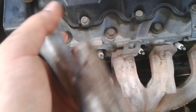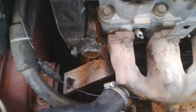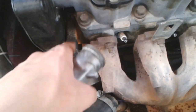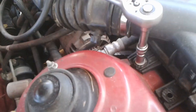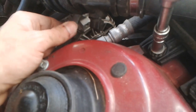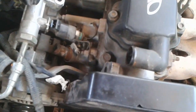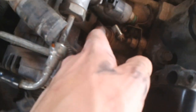The worst part of this engine is the cooling system hose outlets, which tend to rot as you can see here. Our engine's outlet is not much better, but I've got a new thermostat cover - a used one that the guy who sold me the engine gave me. Those plastic materials used on such things are the worst you can have on a car engine. When removing those two screws I noticed the sensor was unplugged - that's weird. A lot more stuff has been stripped and removed. Another thing I noticed was that this outlet was almost completely blocked - there was a big chunk of rust and gunk. Part of the overheating issue could be due to these blockages.